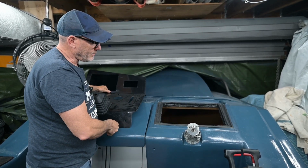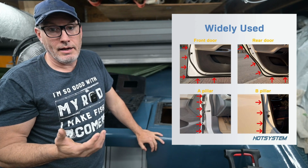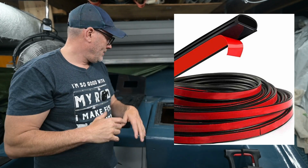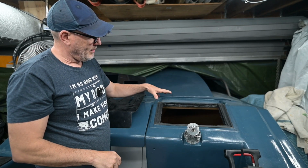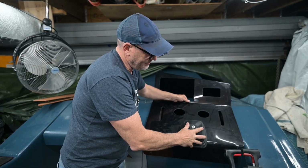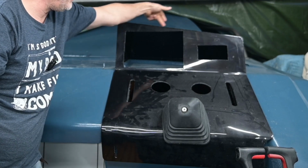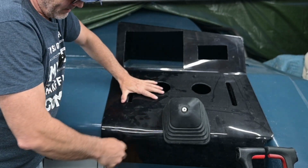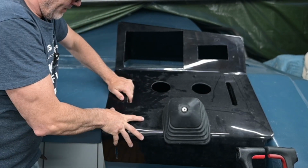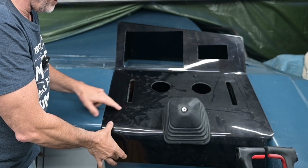So what I came up with was double gaskets. So these are just car door gaskets. They're kind of shaped like a D, so then once they're compressed, they make a seal. I've doubled them up here in the attempt that when I install the acrylic dash, which will sit nice and snug around the curb here and get fastened in, and then when I put my fasteners or my bolts in through the bottom here of the acrylic, it's going to compress everything, put a downward force on it, and then activate those gaskets, and then hopefully create a nice seal.